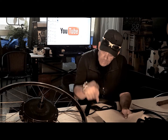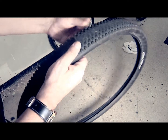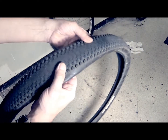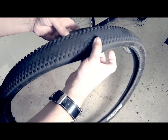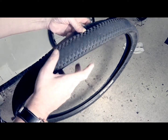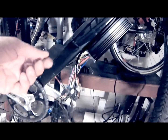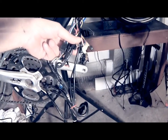If you enjoyed this video, please subscribe below. Thanks so much for watching all of our videos. Today I'll be changing my rear tire on my 1,200-watt e-bike. I got a flat because my tire had worn down significantly over the 4,000 miles I put on it, as you can see. Your e-bike tire takes a much bigger pounding than on a regular bike due to the extra weight and vibration. In order to remove the wheel, the first thing I have to do is disconnect the motor's wire connections to the controller.